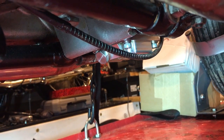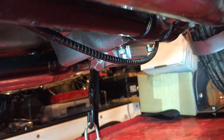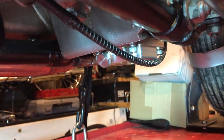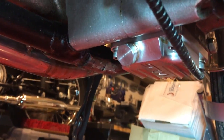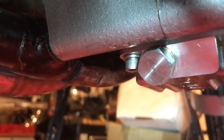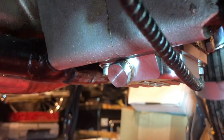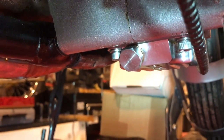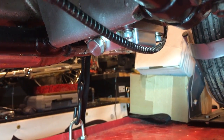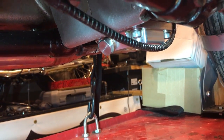One of the bigger problems with this bike is that it wets a lot. And so instead of having to keep removing this sump cover, what I've done is installed one of these new SRM sump plug plates that comes with this integral removal screw. It's a really nice bit of kit, actually. But I've still got a couple of leaks, and I think what's happening is it's leaking through the threads of these Allen bolts. So I've been through and added some plumber's tape. That seems to have cured it for now, but I'll take another look, maybe once the bike's had a little bit of a run.